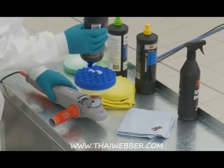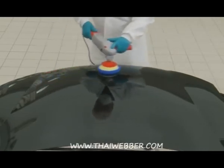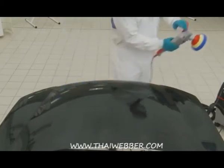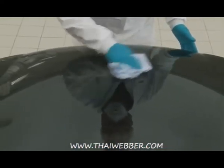Gary applies the Ultrafina to a blue polishing pad and works it into the panel with a 3M electric polisher. It should remain liquid in use, unlike other compounds and polishes. Excess residue is wiped away with a blue high performance polishing cloth. This is an ultra soft cloth to ensure that light scratches are not introduced at the final stage.